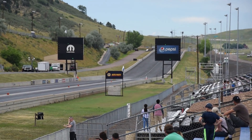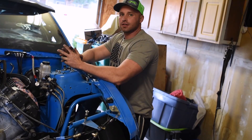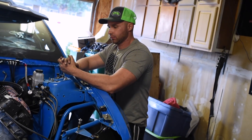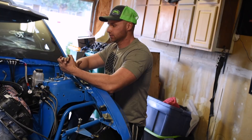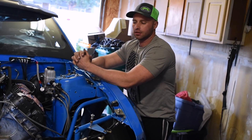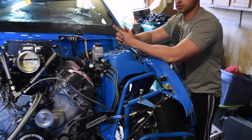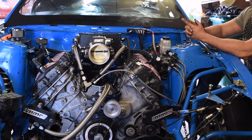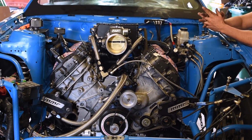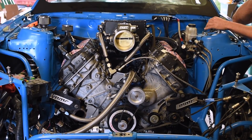Zero radiator on this car — coolant comes out of the icebox to the air-to-water intercooler reservoir. The air-to-water intercooler for the turbo system all plumbs in with the heads. Running a big transcooler in the back and monitoring it through the Dominator — it'll go into safe hold if it gets too hot. That's the benefit of standalones — all the safeties you can program in.